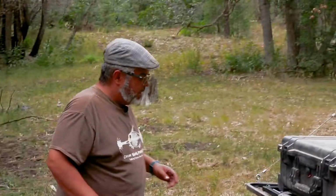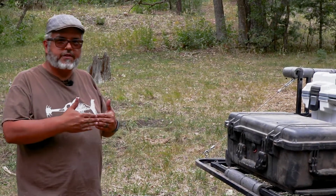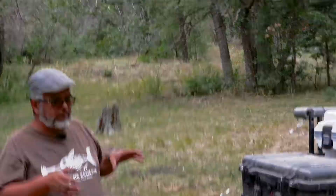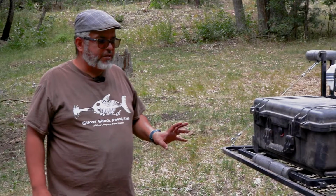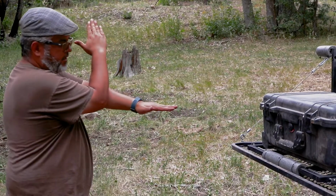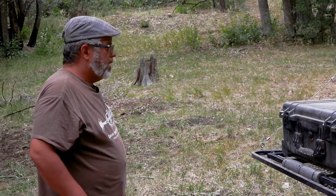So a little bit more on the vehicle itself. It has independent suspension. Honda, for instance, likes to have a straight axle suspension. It's pretty useful if you're on a farm, because if you put a big load on it, it's sharing a suspension, so it's not going to want to lean as easily. But when you're out on the trails, a single axle suspension does beat you up, because you have basically a shock arm like this and the axle like this. So if it pushes, it's all at once versus independently going up and down.